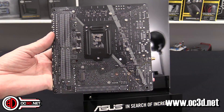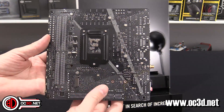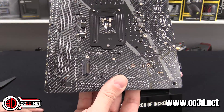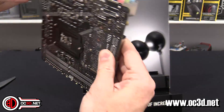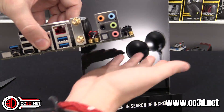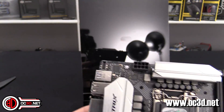If you wanted to access the rear M.2, you could get a Dremel and cut a bit more out of the back panel. Since most ITX builds already have a CPU backplate cutout, you could easily extend it — it'd only take about five or ten minutes. The only issue would be cases where the board lays flat with the power supply directly behind it.